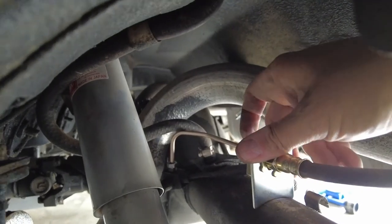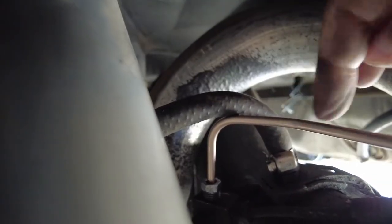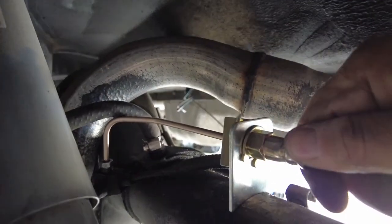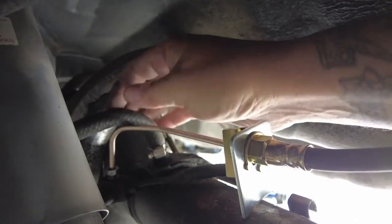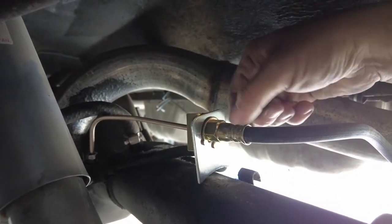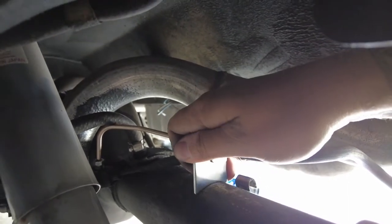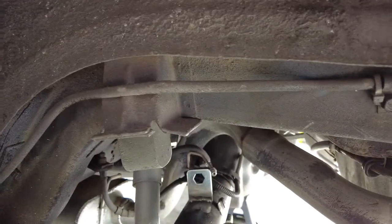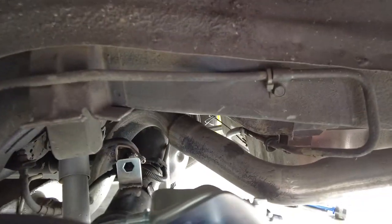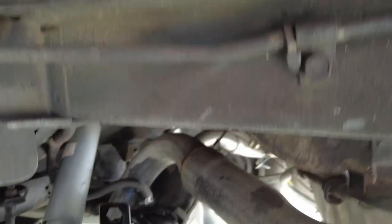Here's my tab - it's going to sit perpendicular to the axle tube, so that looks good. I just kicked a 30-degree angle into the tube and it goes into a straight shot. There's a little rubbing from the vent tube but barely anything - I'll try to move that out of the way. Now I'm going to get the flap disc, clean the axle tube off, and tack the tab in place. I've got the brake tab mounted, I just need to degrease it some more and hit it with some paint to keep it from rusting. Then I'm going to reassemble everything. Tab is painted - time to reassemble.